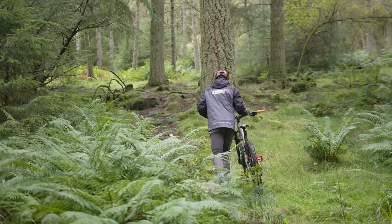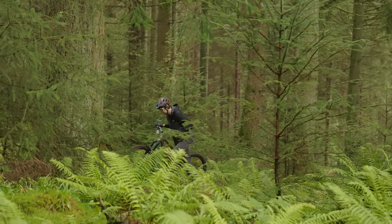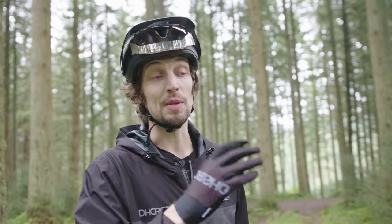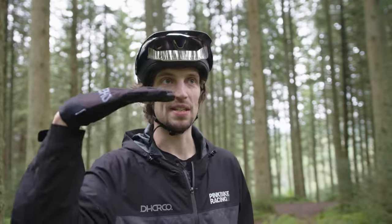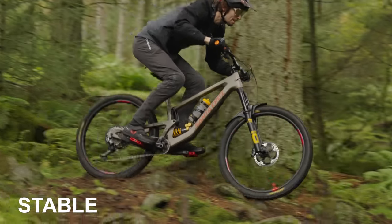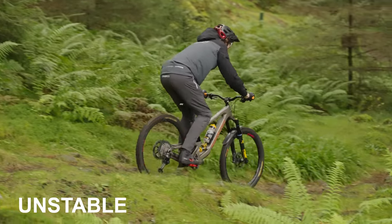Work your way through the adjusters over a few rides and you'll find yourself understanding a whole lot more about how your suspension works, with a bike that rides way better. This process can feel a bit daunting but in essence it's super simple and easy to follow. Quite often when riding and changing things you'll think you didn't feel much of a difference — that's why it's good to make big changes. If you're unsure, time it, or set up a tripod or phone on a rock and film it. You're looking for the setting where the bike is the most stable — the front triangle, bars, pedals — the least amount of movement. Film both settings, compare both, and whichever gave the most stable bike or fastest time is your winner.